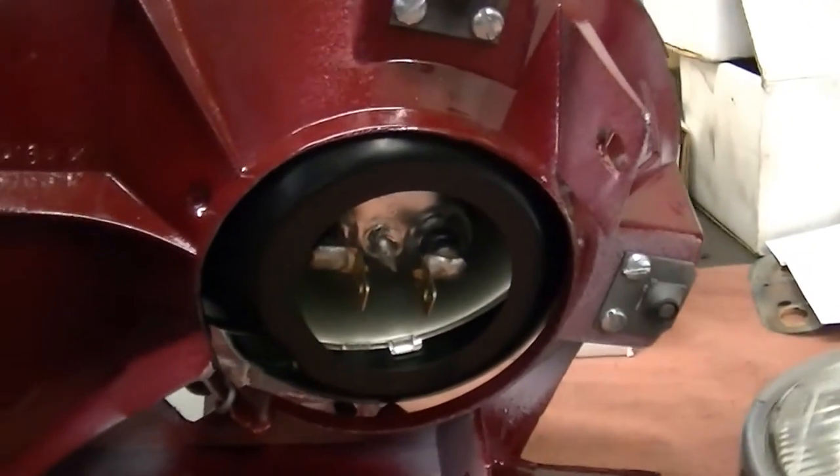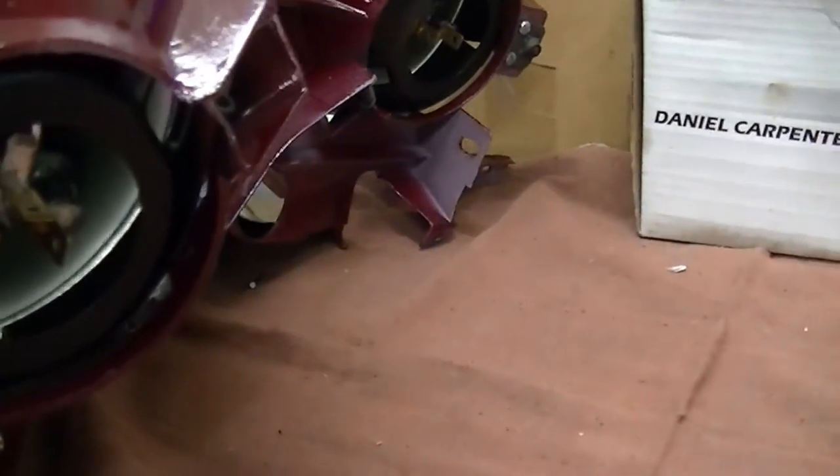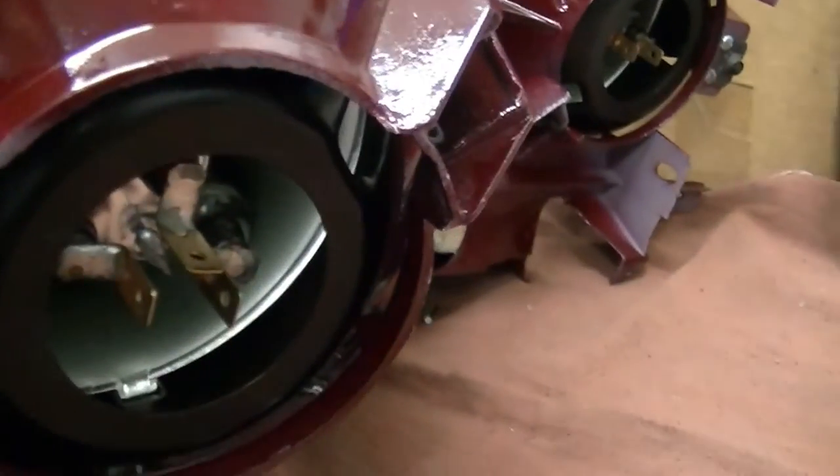It's got the proper new rubbers here. I'm going to go ahead and put this other lamp in and show you what it looks like when it's finished. Here's the spring without tension on it, and you can see it's lined up to go into both holes there. I use needle nose — this seems to have worked pretty well to pull the spring. But you got to hold it with one hand and pull back with the other to get it to seat.